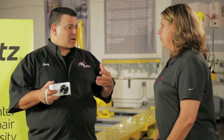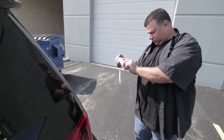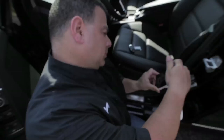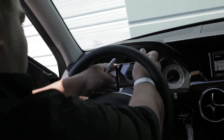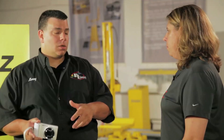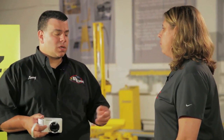For your own protection, follow a general rule: you want the license plate, the public VIN in the windshield, and then check that against the VIN sticker on the B-pillar, the door, or in the glove box. Get a picture of the mileage. You might also want to start the car if it's safe to do so — meaning the oil is inside the car, it wasn't a rollover, and you don't risk hydraulic lockup.